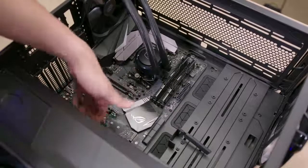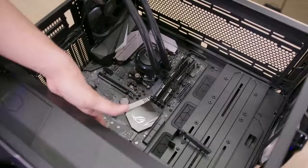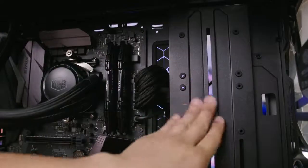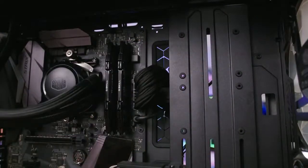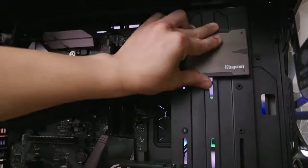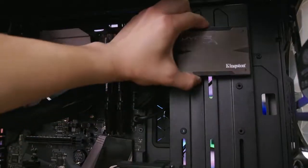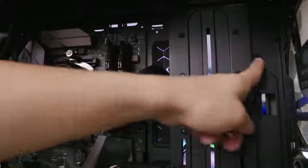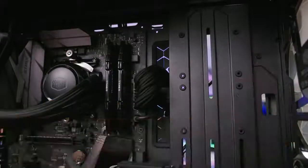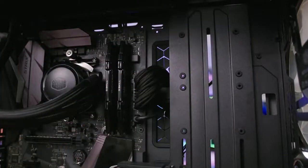At the very foot of the motherboard, you'll find a fairly large cutout for routing additional cables — this is sort of a missing piece of the power supply shroud, so it's not very visible and doesn't need a grommet. This is where you'd route SATA cables, particularly if you're mounting SSDs to the top of the power supply shroud. Over here, a steel panel can house two 2.5-inch drives using handy little peg screws — you screw them into your SSD and pop them in like pegs. Virtually tool-less and very easy to use. There are also flexible mounting strips for a reservoir if you want custom water cooling.